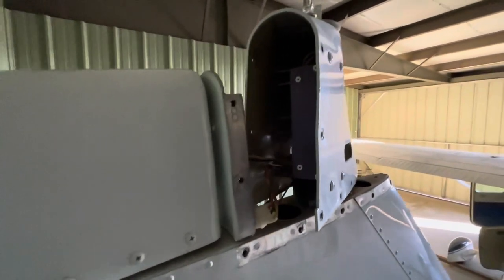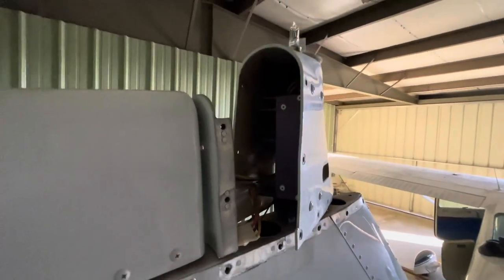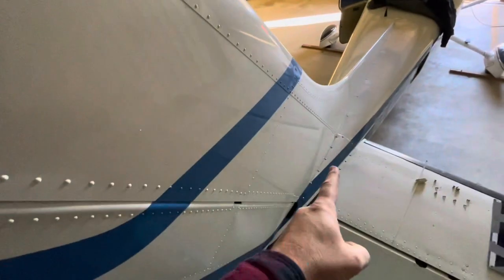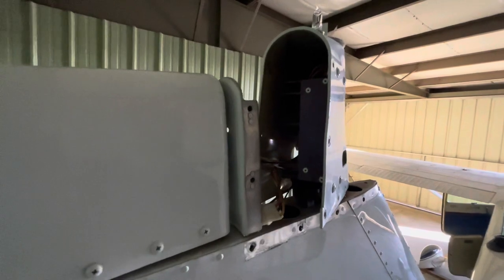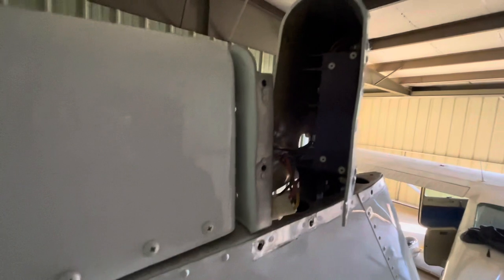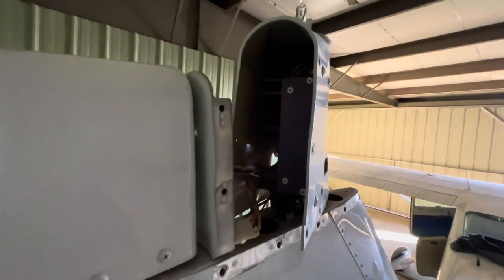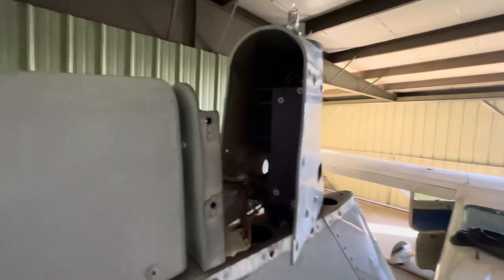For about 500 bucks you can get a Whelen replacement, so I'm going to take this off. I actually have a tool to test the transformer, but I'll bet it's no good. The only way to really test it is to check voltage coming in — we took the fairing off on the other side and put a meter on it to make sure we had 24 volts going to the wire connection. Sometimes you can turn these things on and actually hear them clicking or making a fuzzy noise, which is also an indicator they're failing.